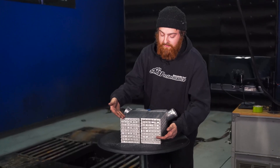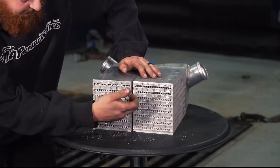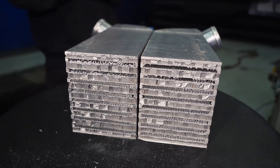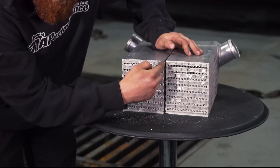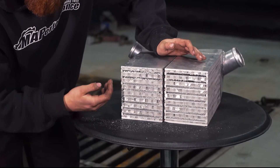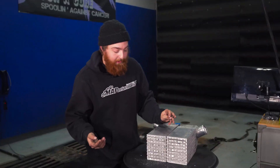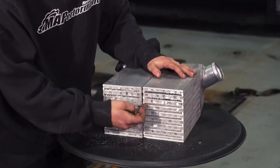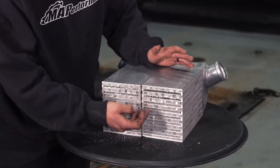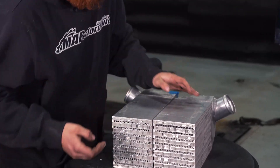Now you guys can obviously see a much better display of what's inside of the intercooler. There are these bars that have a fin array inside of them as well to help promote heat transfer. Your inlet air is going to pass through these individual bars, and the ambient air going through the intercooler from the outside is pulling the hot air out of the inlet charge — those fins are stacked above it. When we're talking fin density, the really crucial point is the fins inside of the bar or inside of the tube, depending on what kind of intercooler construction you have. These are going to dictate essentially what your power levels are, and also what the pressure drop between each end of the core is going to be.